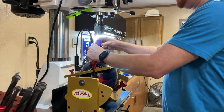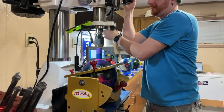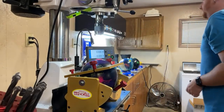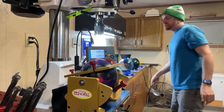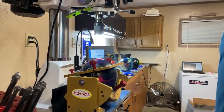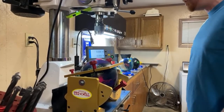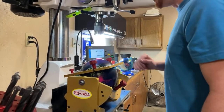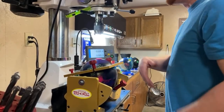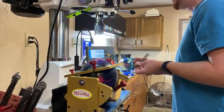Okay. So this should go in. This should be pretty. All right. No squeaky. Pretty simple. And actually I don't mind reslugging stuff because I take the time to do it right the first time. And then generally the slug goes in. It's still snug, but it goes in a whole lot easier. There's not the fear of it locking up halfway down and having to cut the top off of it and then line it up and drill the thing back out, and it's just a pain.